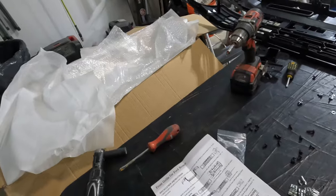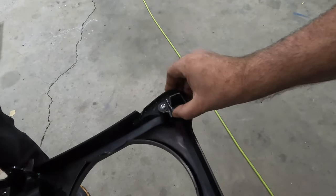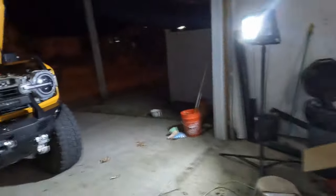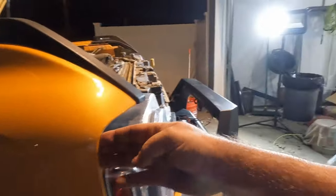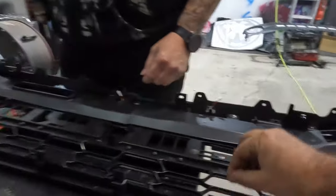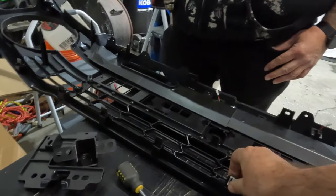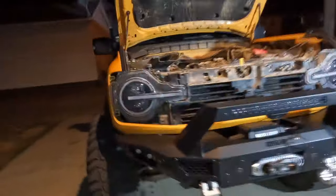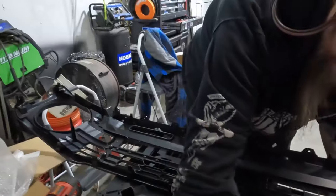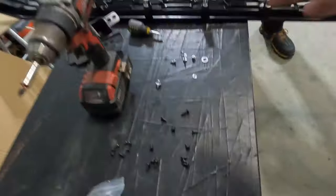We still haven't figured out what the purpose of these pieces are — they kind of help line up along the edges because when you install it, it should go on the inside of the fender, so it's just an alignment thing. Then the last step is to install these metal clips on all these plastic tabs, because those are what will actually clip into all the spaces that the original grill snapped into.